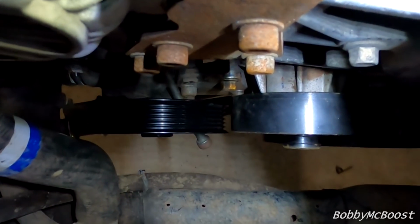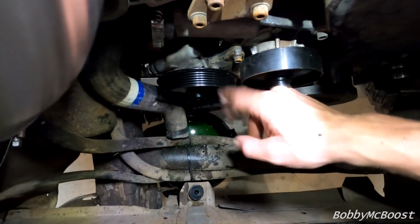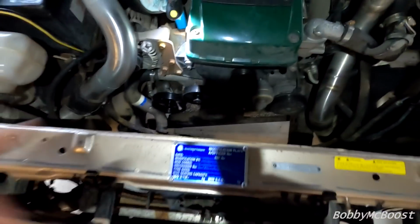And the pulley isn't all the way on. It's close, but it's not all the way on. Close, but not quite. Couldn't get a drill in there to drill out the snapped bit, and it's not on deep enough. So I pulled the radiator out. Might as well clean the mud out of that. While it's out, I'll drill that out, put a new bolt in there, and I'll keep sending it in.